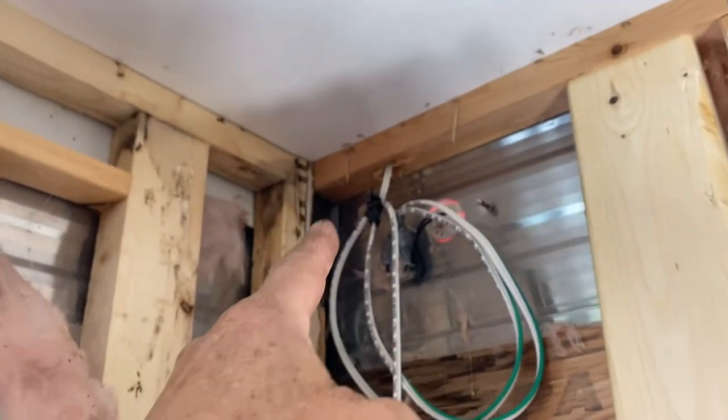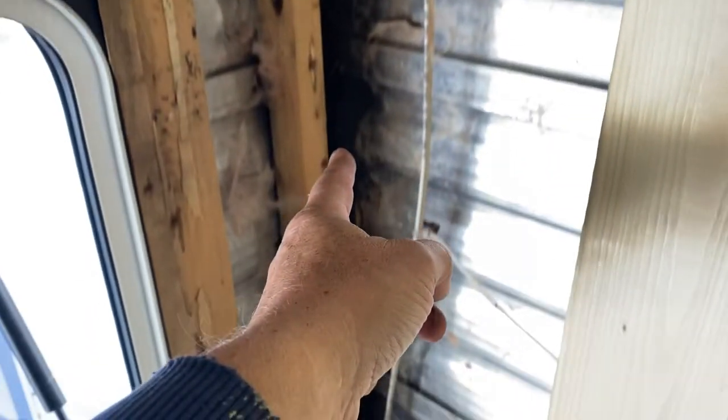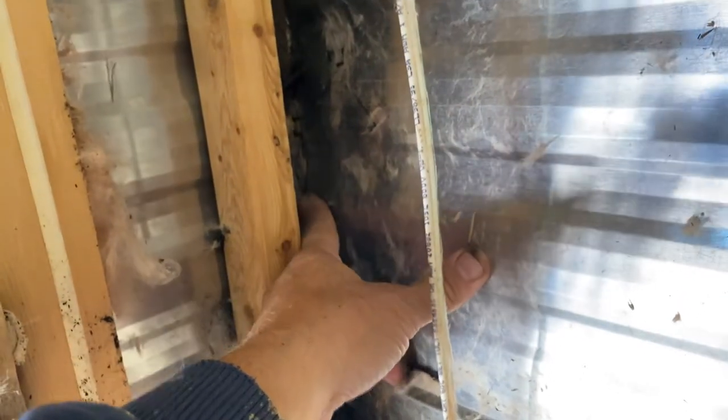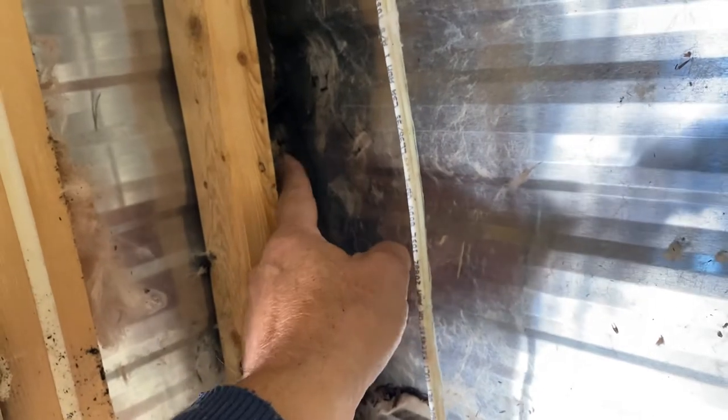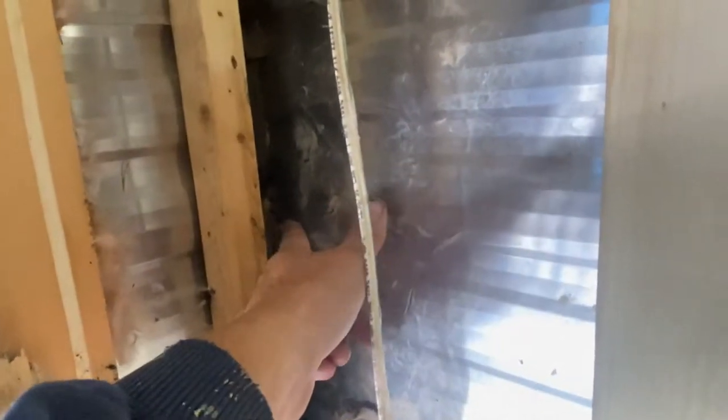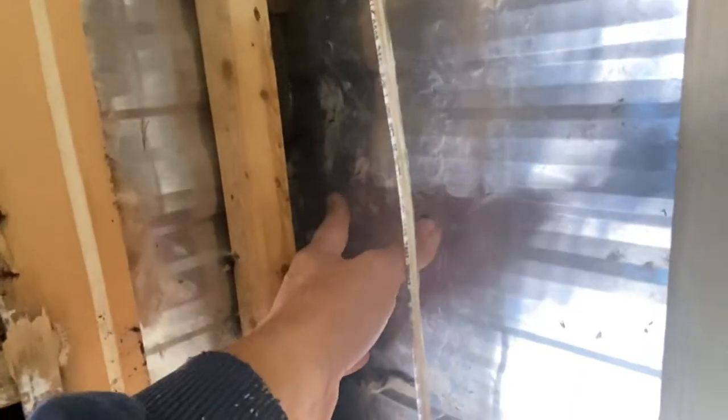I just want to show you this corner — this is all from the corner molding. The roof's good, but this whole corner on both sides — actually all four corners of this trailer — just get water in here from past the silicone not being replaced. Once this board rots out there's no way to hold the corners tight, so there's no amount of caulking you're going to put on the outside that's going to stop water from leaking, because these move and bend.